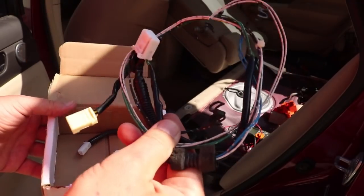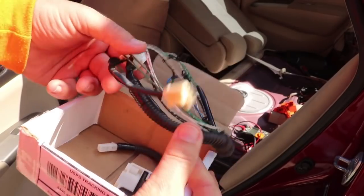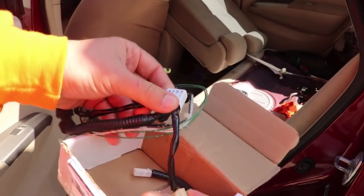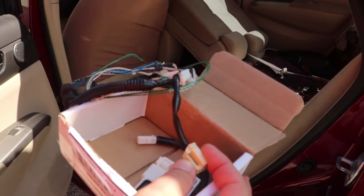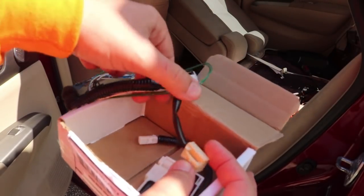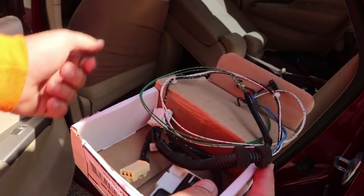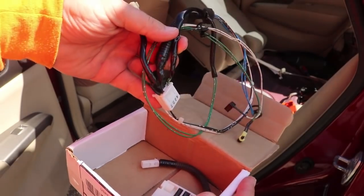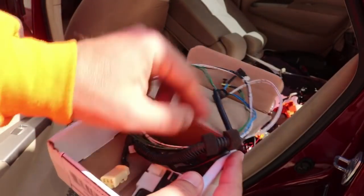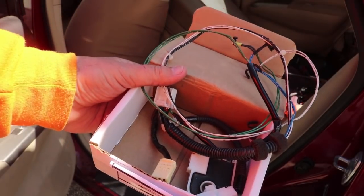This is kind of goofy because it looks like I only needed the shortest little part out of all of this, which is just this little bit right here. The mice completely chewed through those wires, but the whole thing is a combined wire harness and unfortunately these other wires go back in the battery. So I'm hoping I can just replace this, plug it into the current sensor, but let the other wires hang out there, reboot the car, and see if we can clear that error message.